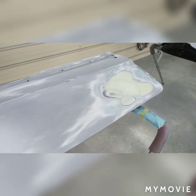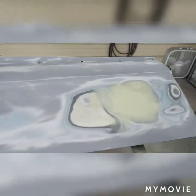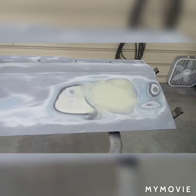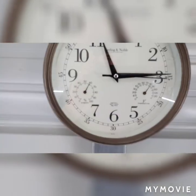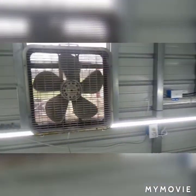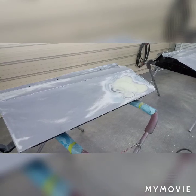Hopefully I got it down pretty good. I'm about to go ahead and seal this off with some epoxy and then 2k it again and start the process over. Just gonna spray some unreduced epoxy to seal all this stuff off so it doesn't bleed black through, then let that cure. It's about 85 degrees and 60% humidity. I did get a new exhaust fan from Tractor Supply for 200 bucks - 3000 CFM. With both fans going it's actually not bad at all in here.